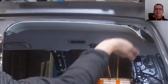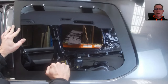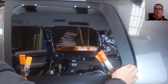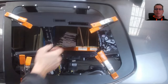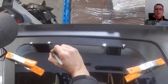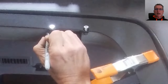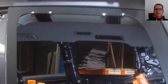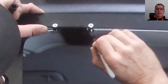I'm going to replace this top interior trim and now I can mark it up for cutting. Putting the frame back in place — this is exactly where you're going to be installing the frame later on. We're going to mark up just those top bolt holes at the top, making some marks so we know exactly where to cut for the support brackets and the bolts. We'll show you later how we're going to make those cuts — this is just marking it all up ready. Now just pop off those two, move it forward so I can mark exactly where the bolts are going to sit against that trim.